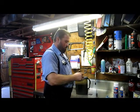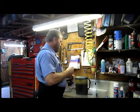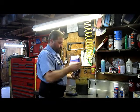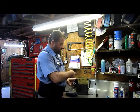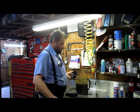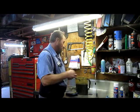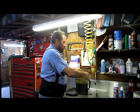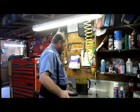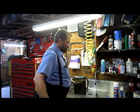For plastic body carburetors, I don't recommend soaking more than four hours. It's a very strong cleaner and they recommend from the factory not to soak it too long. I'll soak them about four hours — sometimes I get busy and they might sit in there a little bit longer than that, but four hours is generally as long as I'll keep them in there.